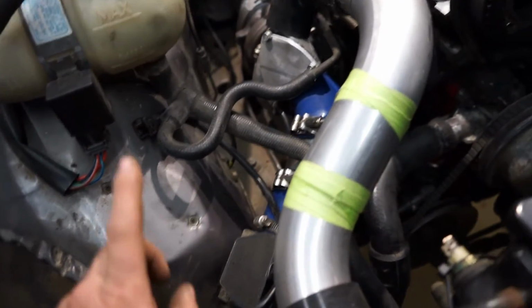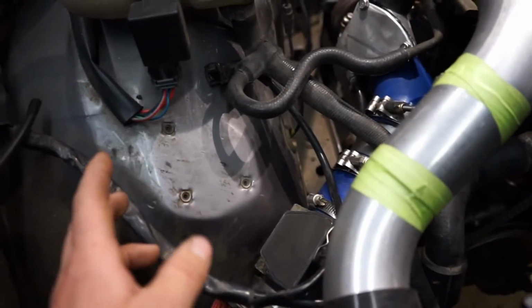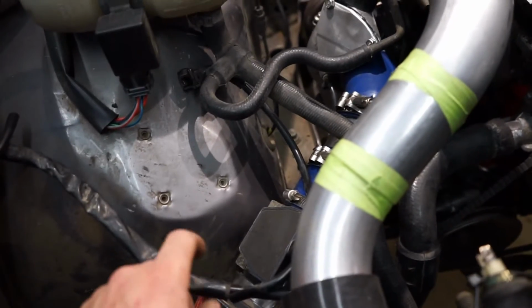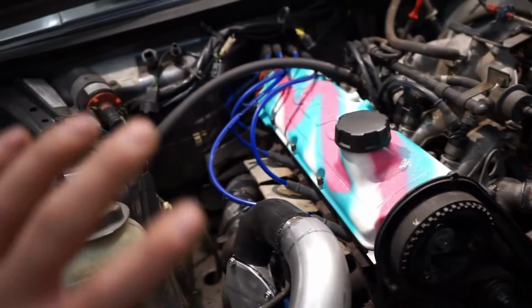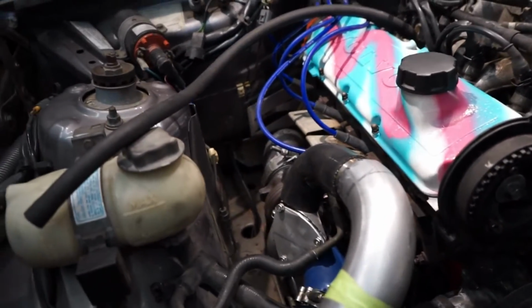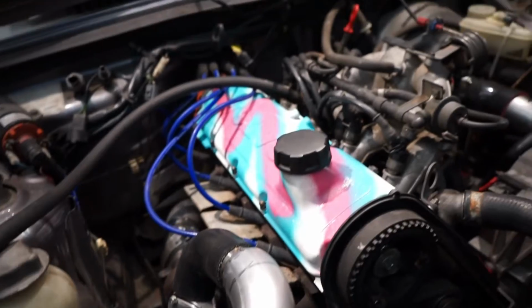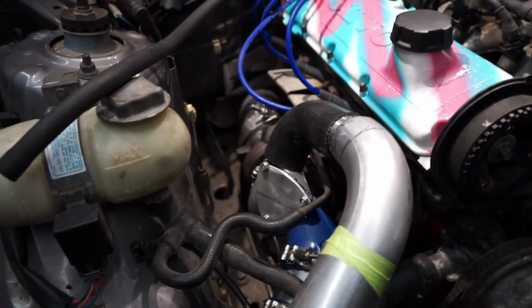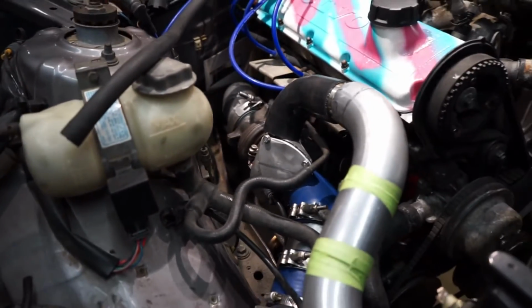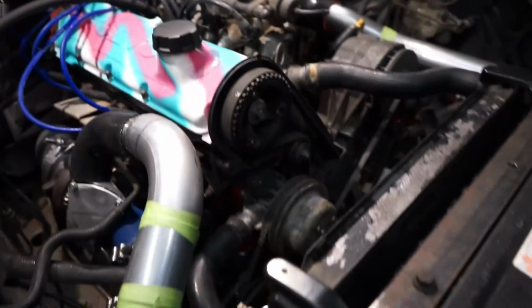They know already what I'm doing, but for those who don't, when you want to run higher boost and make more power, you start to run into scaling issues with the stock MAF. The closed loop stuff is fine, but in open loop, if we start putting in bigger injectors, it's just referencing the maps in the ECU without any input from the O2 sensor, so we have to scale it around a little bit. Apparently the golden combo is 50-pound injectors, which is what those are, and the 3-inch MAF. With a little 15G, I don't even know if I'll get to that threshold, but we might go for more power later. It does have the IPD cam in it, so it should be a stout little performer. We'll see how it goes.